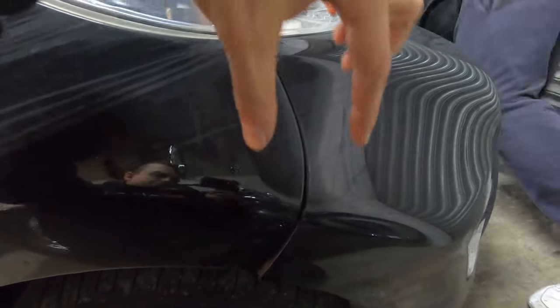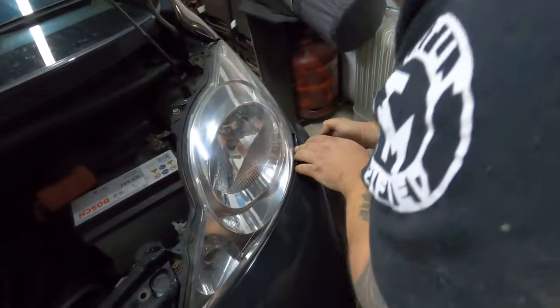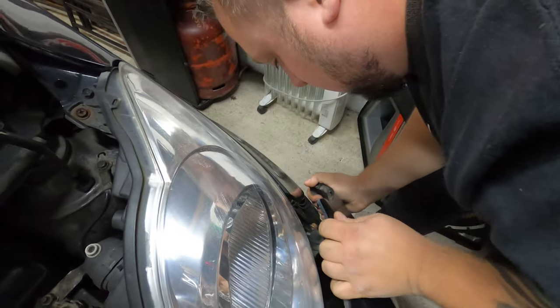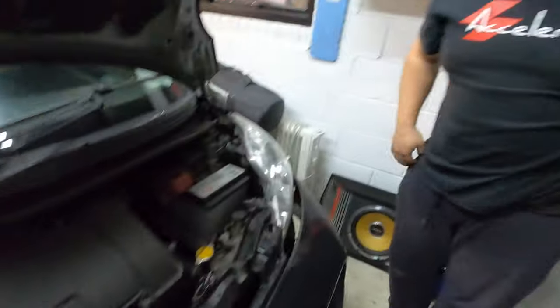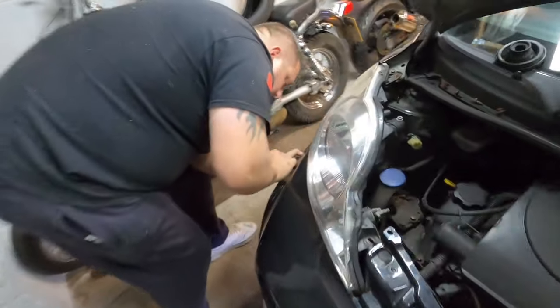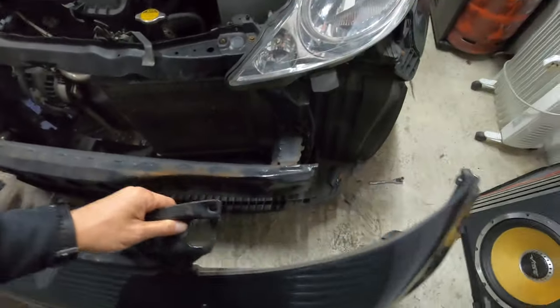The most annoying part is just on the side here — you've got a bracket and there are tabs that are held in, about three of them. The idea is to just gently pull them out. So the bumper's off. As you can see on the bumper, it's got these little slots here which fit into these tabs. What you've got to do is push the bumper towards the back of the car and then sort of release it slowly for each one. It's strong but firm, and then you've got to be gentle.